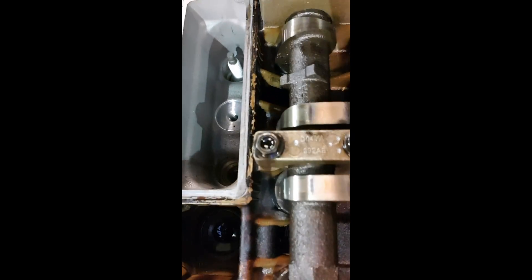So timing train's off, simple as that, ready to go. You can see that's all off there. I've marked my camshaft because this could be sat in a box for a couple of weeks, so I just want to make sure I know exactly where everything's going. I've also marked all my caps as well — it's something I like to do. It was just the way I was taught when I was a kid, so I just carry on doing it now. It doesn't hurt — if something goes back where it came from, it's probably going to help it.